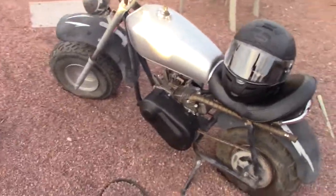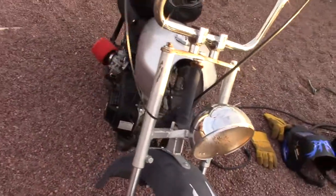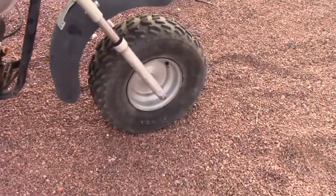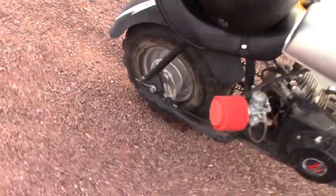All right, there you go — she runs! She's running a little lean because I don't think the fuel is mixing right, but she is running. As you saw, she was actually flying. I tried filling up the front tire again and it turns out it's a bad tire — it leaks through the bead — so I'm going to find a side-valve tube and go tube-in on that one. The rear tire is a little dry-rotted on the sidewalls so I've got to be very careful. There's my helmet — thank you Bell for making that. There's tape over the logo because it has my old job's name on it and I don't want to put that out. I'm going to be putting my own patch there. This project ain't done yet, so let's have a little fun — see ya!